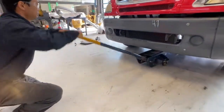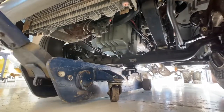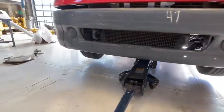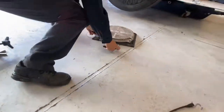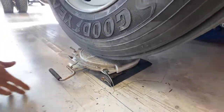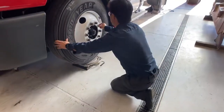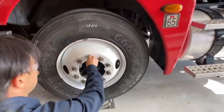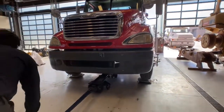I'm going to raise the vehicle using a suitable jack — this is a 10-ton floor jack. We are raising the vehicle to place the turntables under the front wheels. This will allow the wheels to turn freely on bearings so we don't scrub the tires on the ground and create excessive resistance in the steering effort. Then we'll lower the wheels onto the center of the turntables and unlock them.